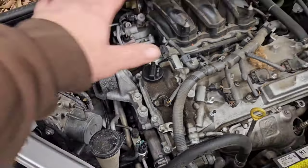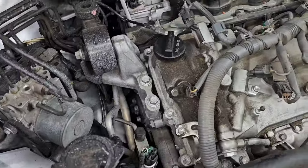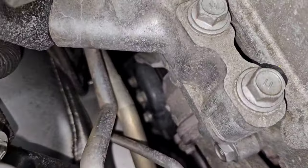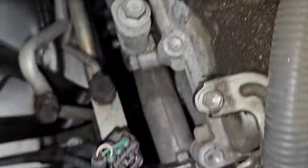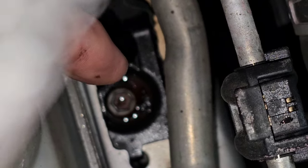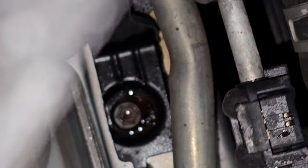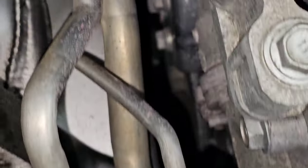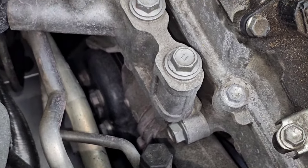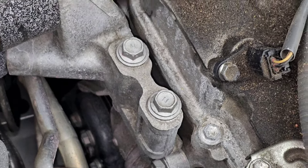So right here, I took the engine cover off — it had a decorative cover on it. There was a mouse under there at some point. But the water pump is down there. If you look closely, you can actually see some coolant on top of the bracket area. There's coolant that's been spraying around, so we're going to have to get to that. I'm going to put this up in the air and start investigating a little bit.